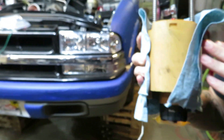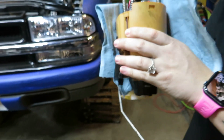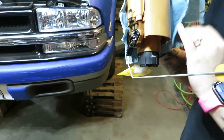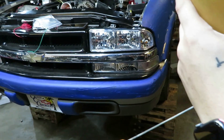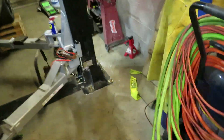So we're going to shove it back in there and see if we can figure out what the deal is. I'm going to hook it up on the outside first, try the key. If it works, I'm going to shove it back down in there. I don't know what we'd chalk it up to — a loose connector or something else. About to plug it in and turn the key and see what it does. Ready? Cycle the key. Still nothing, doesn't make no damn sense. It's got 12 volts coming back.